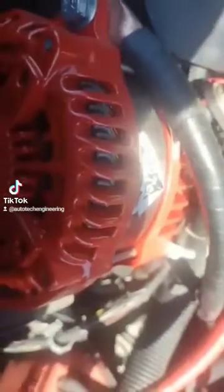When the sticker curls up like this, your unit is overheated — it's overheated bad. Possible causes of overheating are bad grounds or loose grounds, not to mention loose power wires.